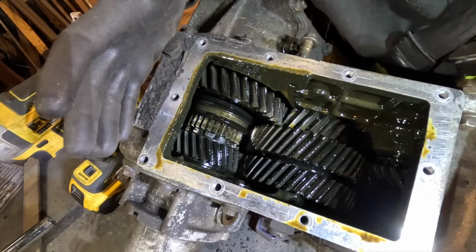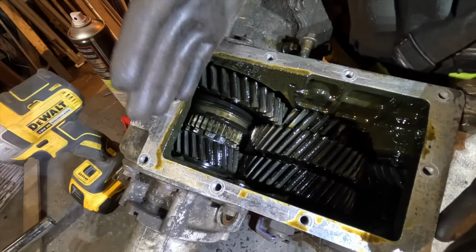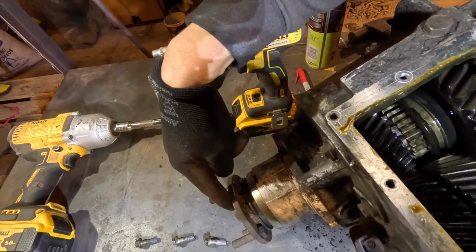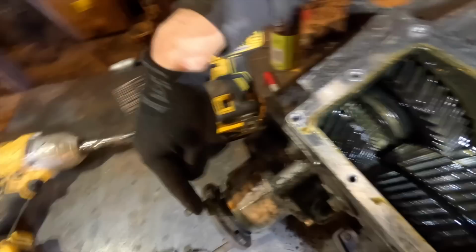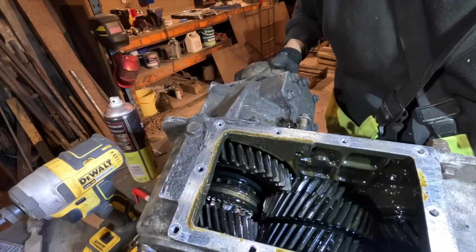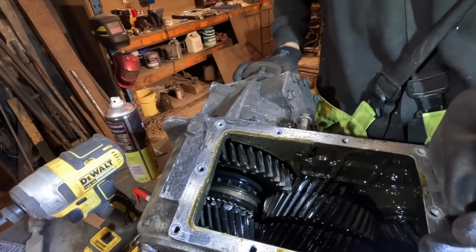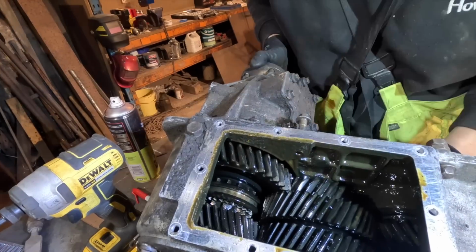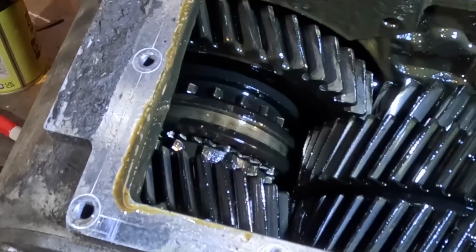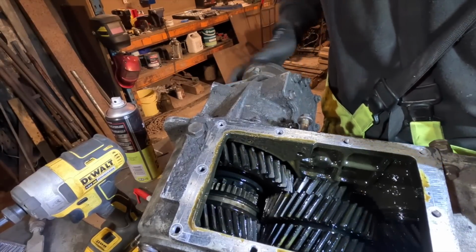Okay, this is the transfer box. Engine shaft is on this side and it transfers its power through these gears to the output shafts. One prop there to the rear of the vehicle and one prop here to the front of the vehicle. That's currently in neutral, so right now there would be no output because the output shaft can rotate and it's not connected to the gears. Now if I shift the mechanism in one direction, that all binds up. So that is in high box.